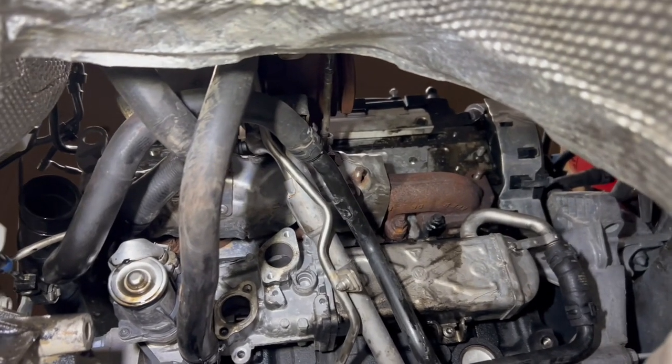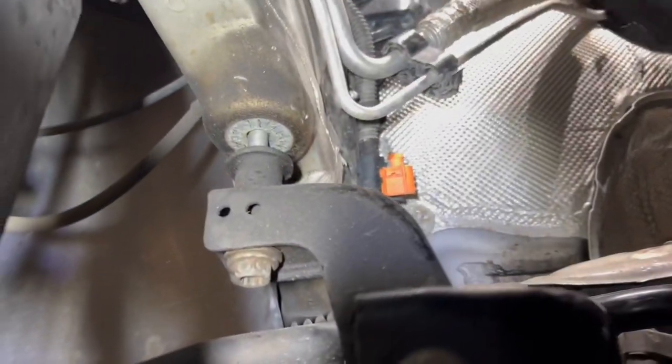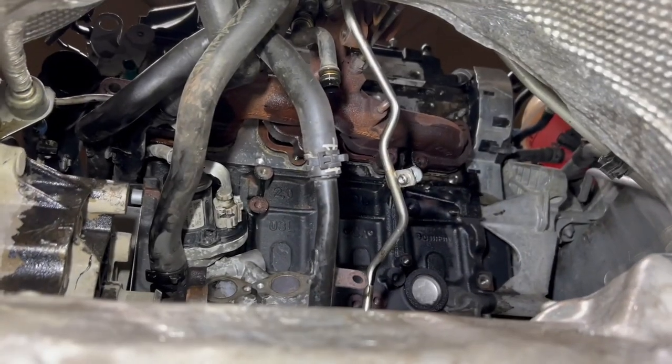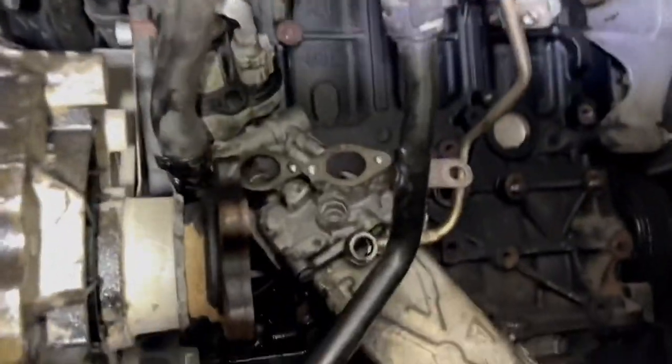These Volkswagen clamps are not the best — they're very small and very difficult to get off. Let's keep going. Hopefully we can get the turbo off tonight, though I don't know if this thing's going to go back together very effectively. The other thing to note: we did have to drop the k-member — it dropped down about an inch and that gave us enough room. Brian was able to wiggle it on out of there.